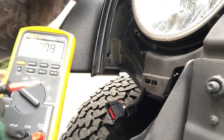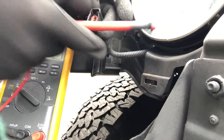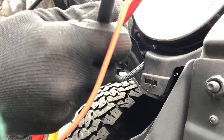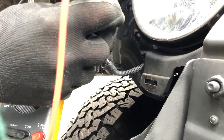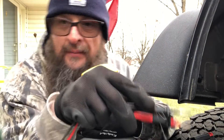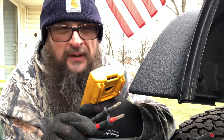That tells me that with a good ground, I've got voltage on the first two. Now, if I took this plug and used voltage from here, I should be able to use that third one as my ground and get readings. And I'm getting like 1.4 volts, and on the other one 1.38 volts. That tells me I don't have a good ground coming from this plug.